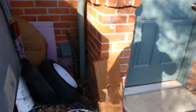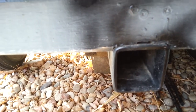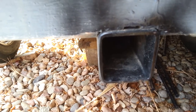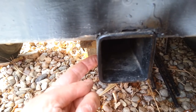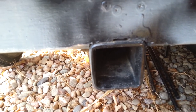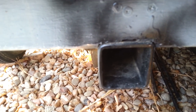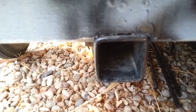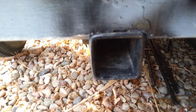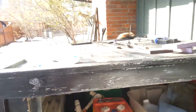...put in probably a thicker gauge material than I wanted — it's heavier, I think it's 3/8 or 6-gauge steel. It's the extended trailer tongue, and I ran it through the whole length of the trailer, extending the front and the back, and bolted it on. It takes so much flex out of the trailer. It's been over the roughest four-wheel drive roads in Wyoming and Colorado. I think this steel extension actually weighed about as much as the original 40 by 48 Harbor Freight trailer.